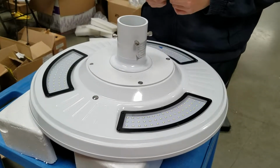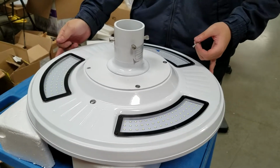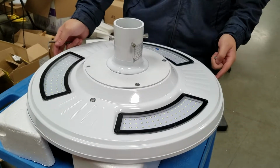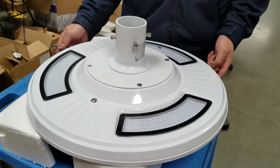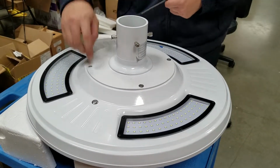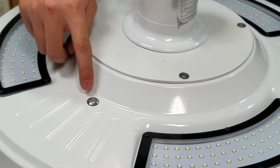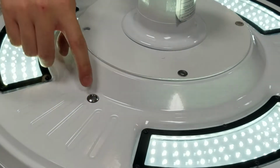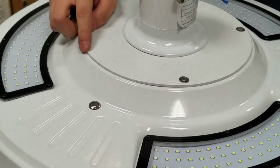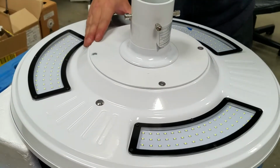All right, so in order to change the battery of this RH15, before you do anything, make sure to put this whole product on a protective space because you don't want to damage the back side of the solar panel. And then check the switch, make sure it was off, like that. So that's on. You can actually see it's going in, so you have to make sure it's coming back on. Now you shut the whole circuit and you should be able to go.